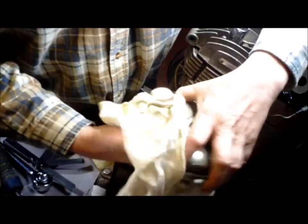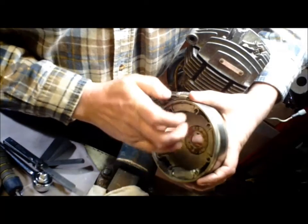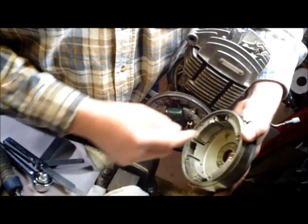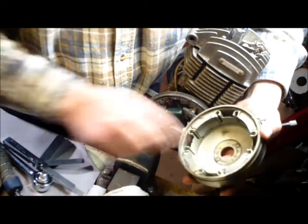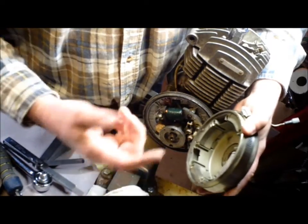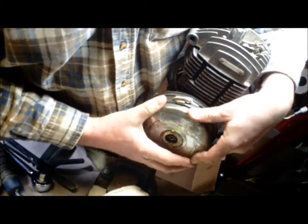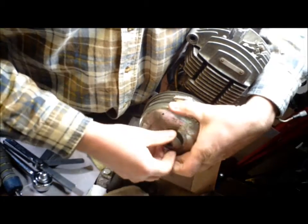Now your timing is set, right where you want her to be. So I put the flywheel back on. When you put the flywheel on, you want to make sure that these guys here are lined with those divots. If these are not into those divots well, what happens is even though you tighten up that Novi nut really nice and snug, because it's off it'll tear in all by itself and it'll destroy that cam, or it'll destroy the flywheel. It can also pop and hop around and start taking out the coils with it — so it's really not a good scenario. Take a look at where they are, slip her on, and you can tell when you've got a positive lock because they'll grip. And you take your Novi nut — keep in mind this guy works backwards.